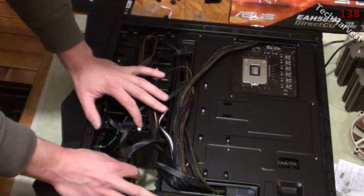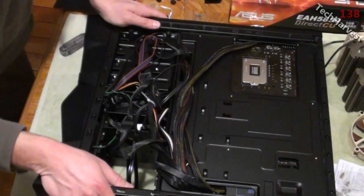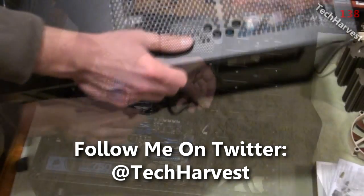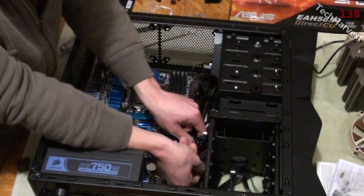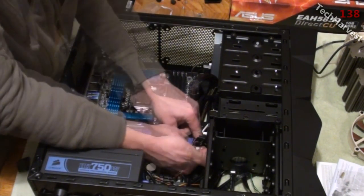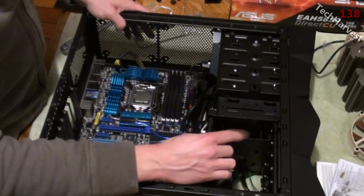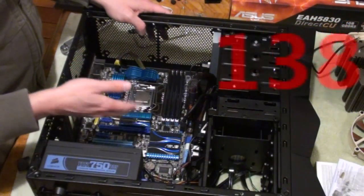The next thing I need to do is plug the SATA connector into the motherboard. I'll feed the cable through here so I can catch it from the front. I'm using the six gigabit per second port, so I just have to maneuver the cable around to fit in there — snap it into place and pull out the slack from the back. The SSD drive is now installed. There are only two things left to do: the CPU cooler and the graphics card.